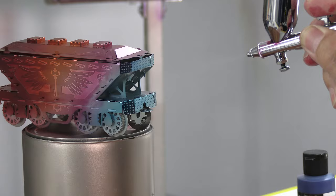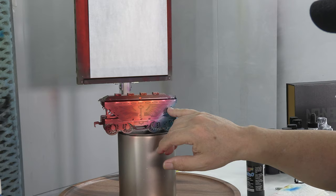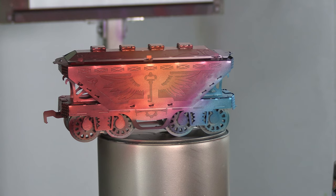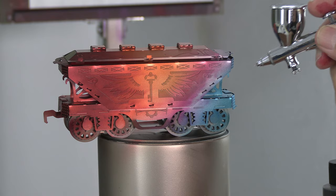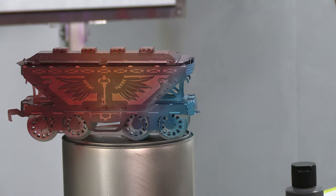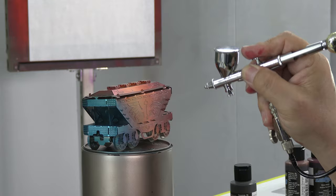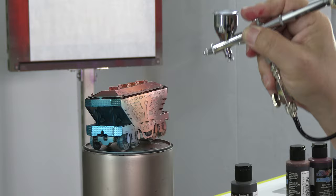Now we're going to work on the transition between the grabber orange and the magenta color. The magenta is to help the transition between those two colors into the blue. So we're going to add tequila yellow candy — of course with a UVLS mix — and I'll spray right there in between those two colors to help the transition. I spray lightly just to handle the color transition. I can even go a little bit over the orange and a little bit on the magenta so that way it's a clean transition.